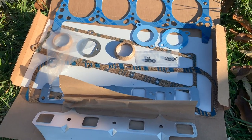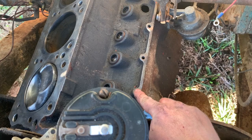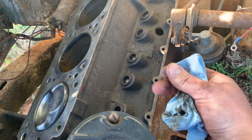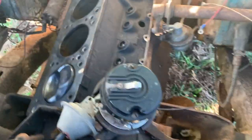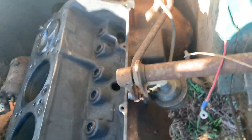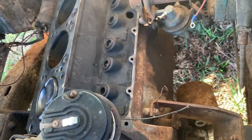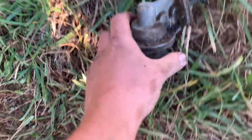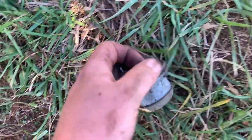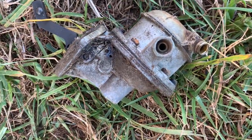So I might leave the exhaust gasket for now and change it later. I went ahead and hit the little side cover with a wire brush and got all the old gasket material and Permatex off. I'm going to clean all the junk out and then we'll be ready to start reassembly. I've got the old fuel pump off - give it a little clean. I think we're in good shape on that, so I'll clean it up and throw it back on with the new gasket.